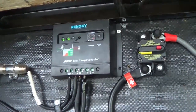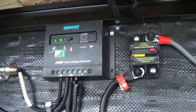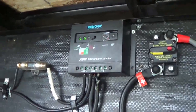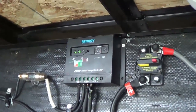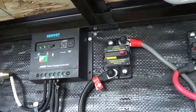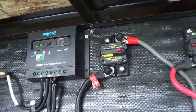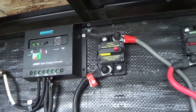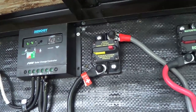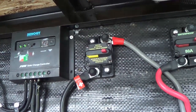When I add the next two solar panels I'll have 400 watts total. This is just a very cheap charge controller that came with my original kit, so I'm going to look at upgrading it. I also want to put in a battery monitor system — I'm likely going with the Trimetric brand. I'll put in a shunt so I can measure what's coming in off my solar and the state of charge of my battery bank.